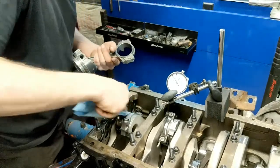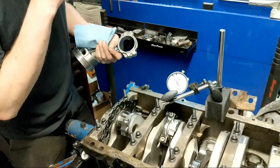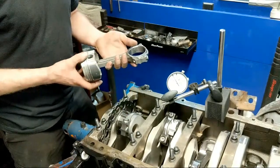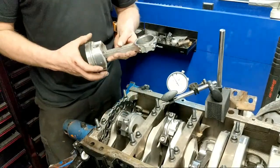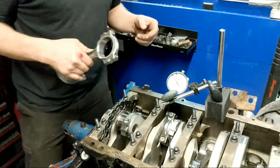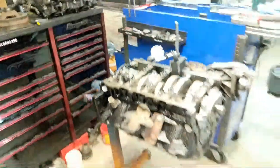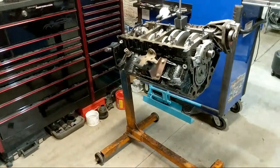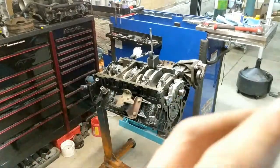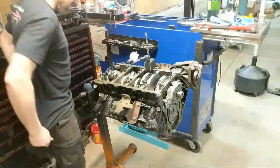Because I don't have the equipment to hone a rod out like that, what has to happen now is this cap where the seams are has to be cut and reset. Being a brand new rod, I might contact Eagle - these are Eagle rods - and see if there isn't something they can do about it. I'm going to have to do some more measuring on this later. That means I have to deal with spiral locks again - those things aggravate me.